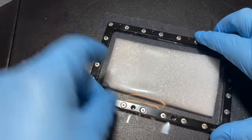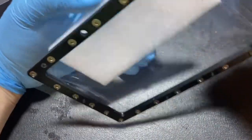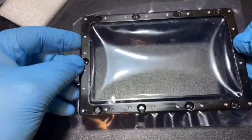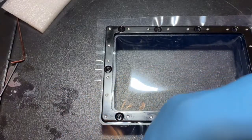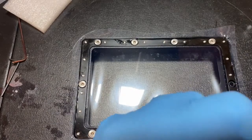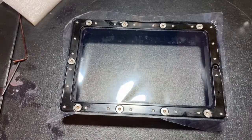You go through here and get everything nice and tight. I usually try to do opposing screws from one another rather than just going left to right. When you're done, bring the actual vat frame in, flip it over, and line it up over the lip — still being a little careful. All the pressure is going to come from the screws. These are the larger screws that take a larger Allen key head. I pre-fix these screws, then once everything is lined up, use a little pressure to pierce through and they go right in. I start by getting them just barely grabbing, not putting a lot of pressure, then go around tightening them in sequence so it's even.